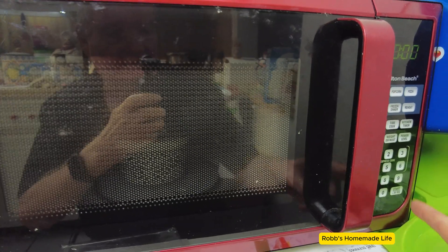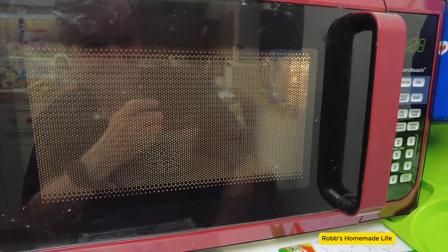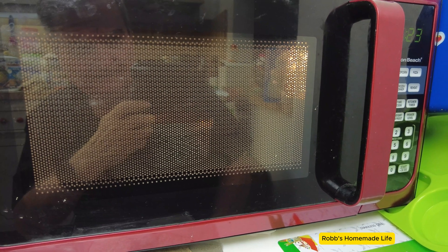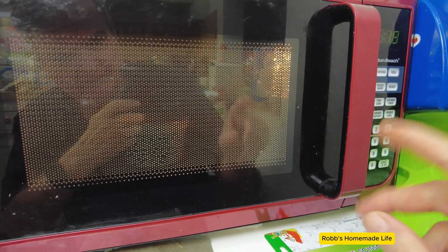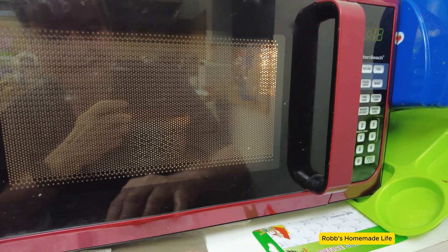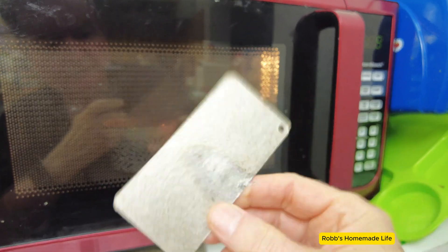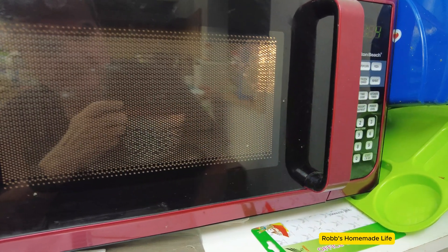I plugged it in — let's see what happens. Oh, that's good! If it is your magnetron, usually you have a smell or a really strange noise you don't normally get. In my case, it was just flames and it was on the waveguide cover. So you can get a replacement — universal waveguide covers, cut it yourself — they fit almost anyone out there.